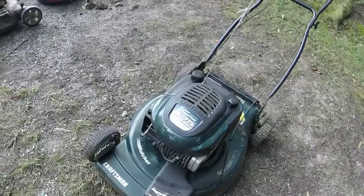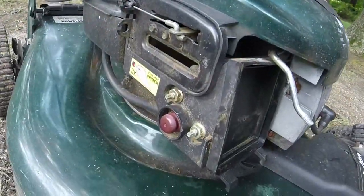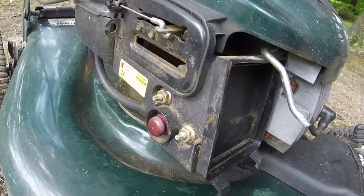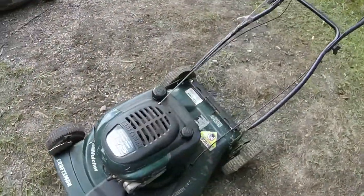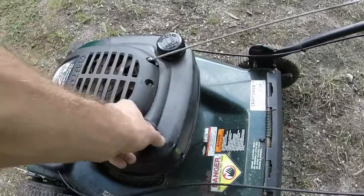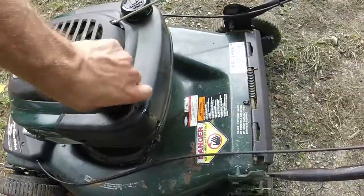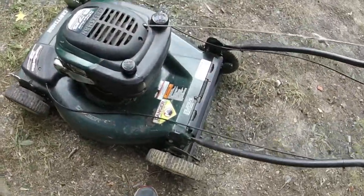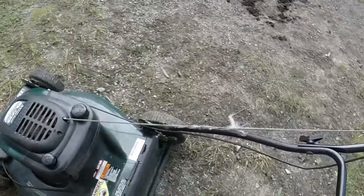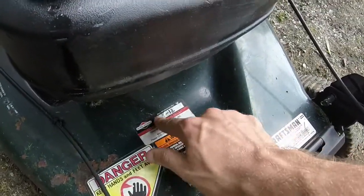This video is going to be about this Craftsman here — looks like it's only the second or third one I've ever had. It's got the Vector carburetor on it, which I believe is what they're called. He did say it ran and would occasionally blow out white puffs of smoke. Taking a look, it's got about twice the amount of oil it needs — not exaggerating. It seems like it wants to crank and run, so I'll drain some oil out and see if I can get it going.